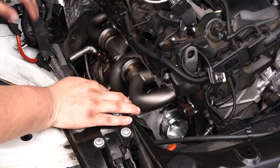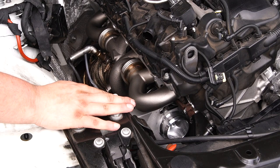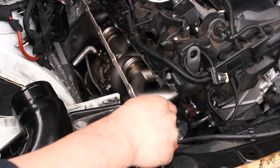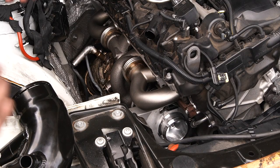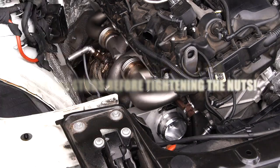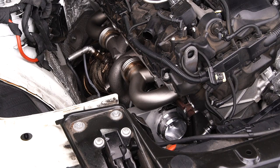The reason that trick works is because the middle part is your exhaust side — your hot side — and that's solid. Your cold side will just follow since it's attached to the manifold and is a little flexible. Once you have everything in place, start putting everything back together: oil return line, coolant line, all the connections. This is the bar that goes on top where the bolts go — place it in and ensure all the top nuts are bolted in evenly. Torque the top nuts to 11 pound-feet or 15 Newton meters.